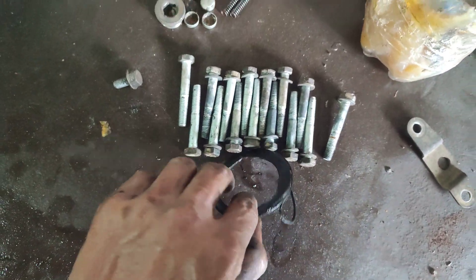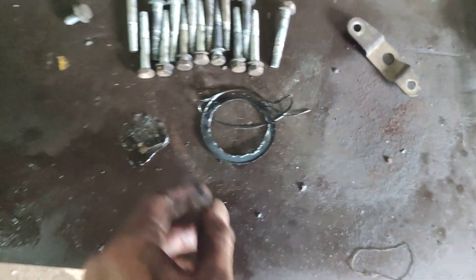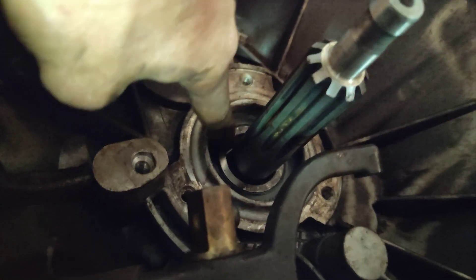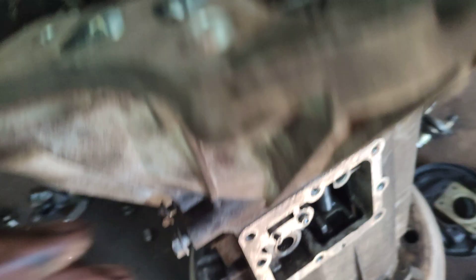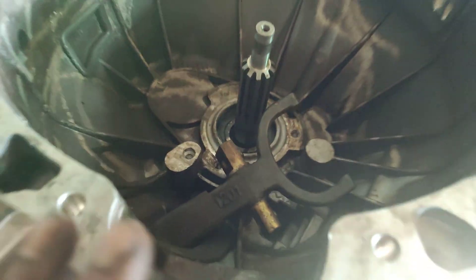I applied heat with my gas equipment — I used a torch. I applied heat with my oxygen-acetylene equipment. Of course the bearing burned. But after heating it a lot, even to the point of partially melting the bearing, it finally started to come out. Otherwise, the internal pieces had already twisted and were about to crack the case or break everything else.